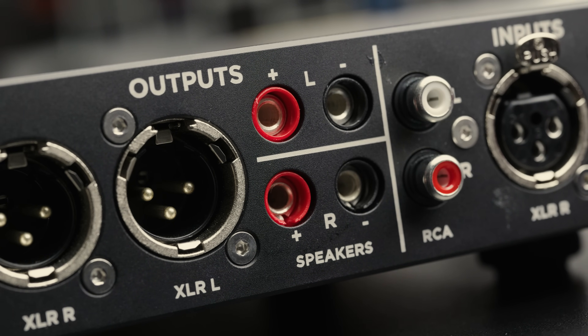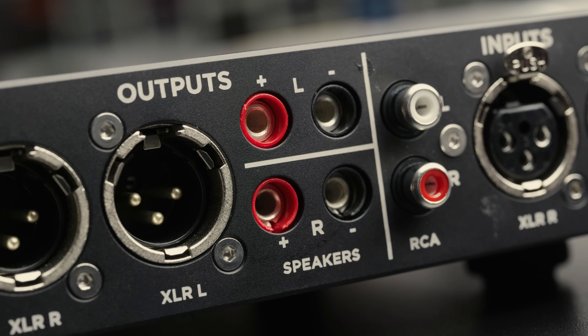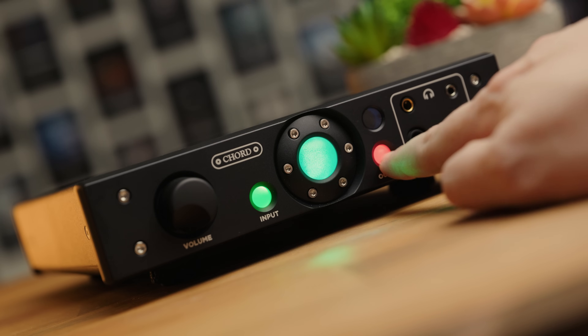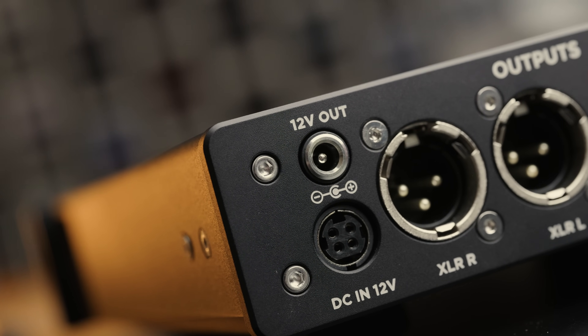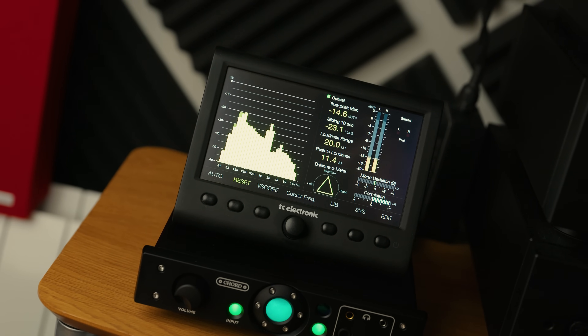Besides the usual inputs and outputs that you'll find on most headphone amps, there are some things here which you wouldn't typically expect to see on competing products. The Alto isn't actually marketed towards the audiophile market — it's primarily marketed towards the professional audio market. So for people wanting to use the Alto as the analog hub for their monitoring or production setup, you can actually use this to directly power speakers. On the rear you'll find some speaker taps, and the Alto can deliver a pretty beefy 50W into 4 ohms or 25W into 8 ohms to run passive speakers or monitors. Or if you're using active studio monitors, you can also use the XLR lineouts, which can be toggled using the control on the front to run simultaneously with the headphone output or swap between them. One other rather unique feature is that it offers a 12V DC power output, meaning you can directly power another device like a DAC, a mini DSP or a monitoring display directly from the Alto itself, which is a pretty neat thing to include.